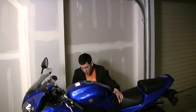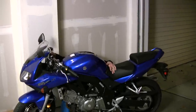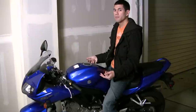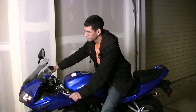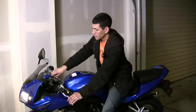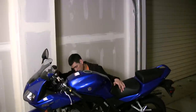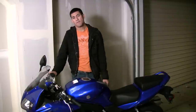I'm going to check the level. Most motorcycles have a window here — some have a dipstick — but this one has a little window which says it's low or full. It looks okay right now, so we're going to start the bike up. We need to let the oil run through the bike because it's going to change the level on the meter. Let it cycle a couple of times through, then check the oil again. Now it indicates it's low, so you jockey back and forth — putting a little oil in, checking the level, starting the bike, checking the level again — until it says full and stabilizes at full after having run the engine.